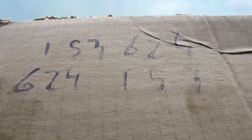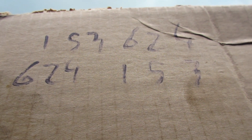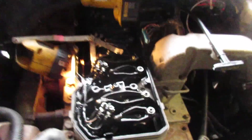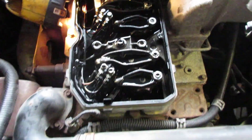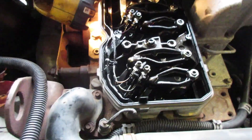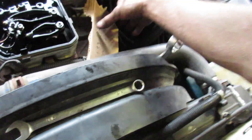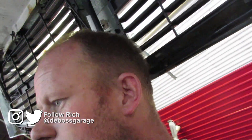I've got my little cheat sheet here to keep an eye on which rocker I have to set when the other corresponding one is rocking. We'll put a link on the other video to show you exactly how to do that. I just wanted to show you guys how to take the valve cover off on the 24-valves and where to set the valves on these and the little trick for that. Very simple — have fun. Your buddy is going to be sleeping most of the time under the truck if he's turning it over, so don't pay him too much.